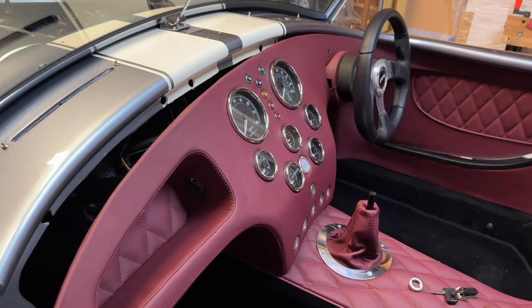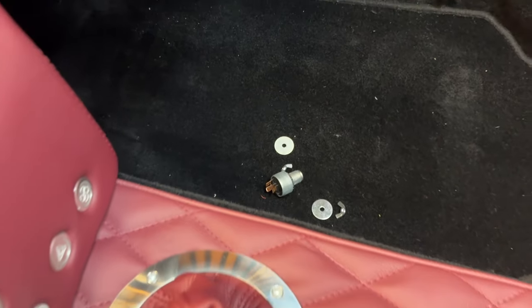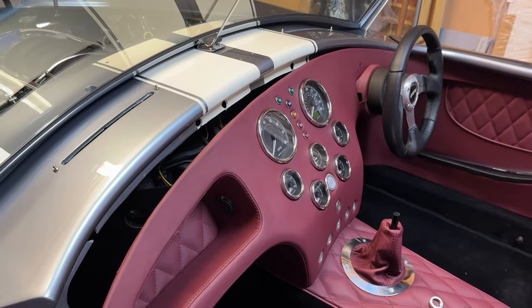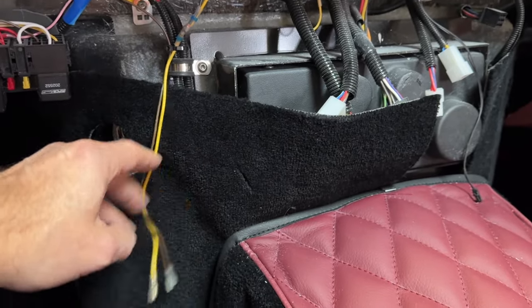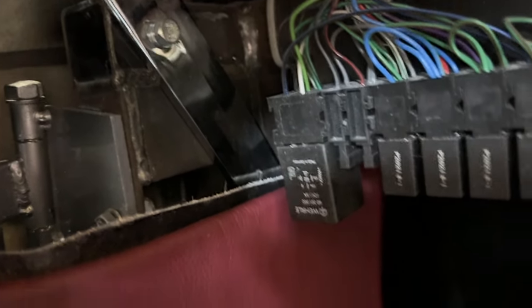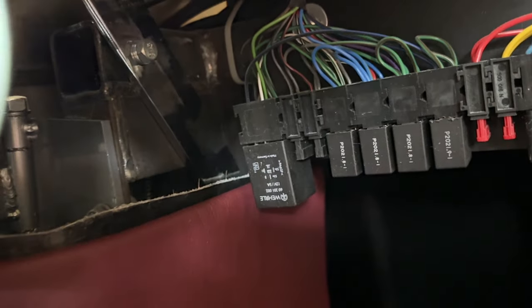They certainly haven't rewired everything back up. I was quite surprised - not only did I not have a battery, it wasn't going to start anyway because no wires were connected to the barrel. So I'm going to have a good poke around in there. Also the guys haven't bothered trimming the carpet around the air vents, so we need to just cut that off - fairly simple. The trim here goes over the bottom bolt for the windscreen, but I can get my hand around there and tentatively undo that.